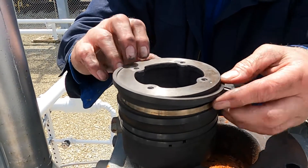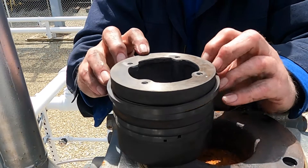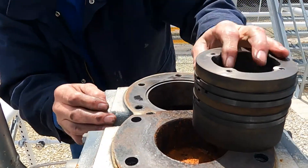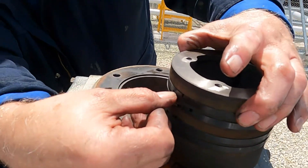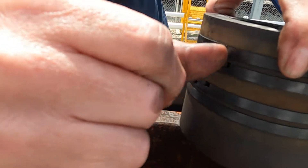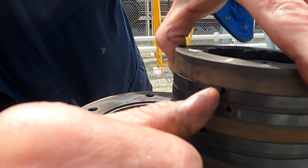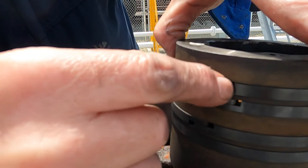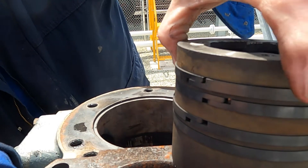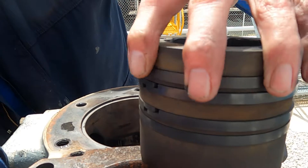What we're going to do is drop this back down and get both of them to line up to drop in. You can see how they lap — right here it's like two L's coming together. Squeeze them together, and you see that gap. For approximation, that's a half-inch lap. If you squeeze these together and you've got a gap close to a quarter inch, it's time to replace your piston ring. The Corken manual says 50 percent — when the wear is 50 percent. You can see these rings are not that old; everything's in really good shape. Just make sure they're staggered.